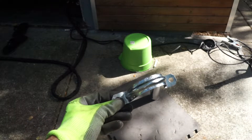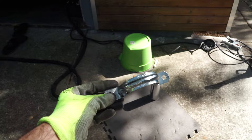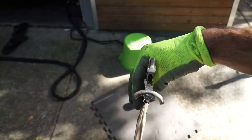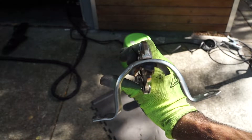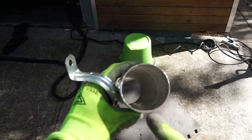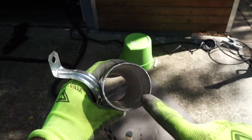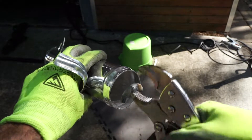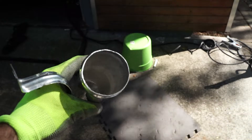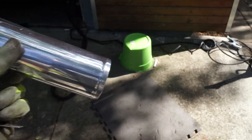For my two-and-a-half inch intercooler piping, all I used was this two inch connector and my round exhaust hanger that is welded to my vice grips. You clamp the vice grips down and then that has a place to go and you just kind of go around the edges. If it starts to deform the inside and make it not round or kink it, you can go back on the inside and literally just bend it back. It's really easy to work with — that's perfect.